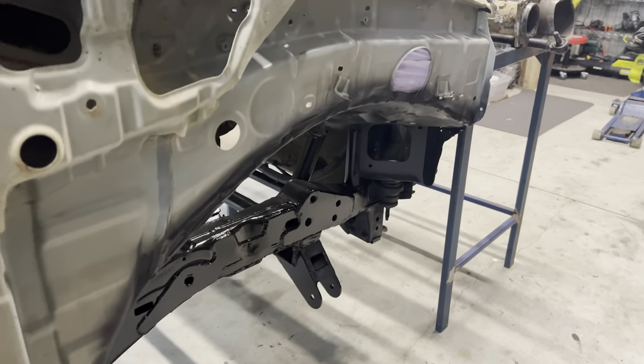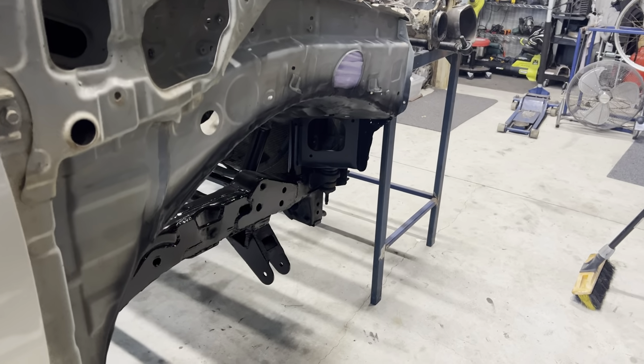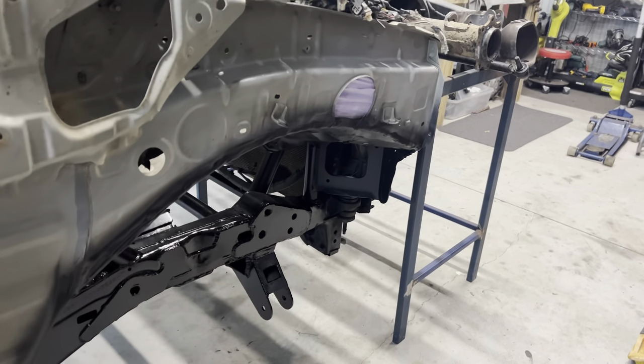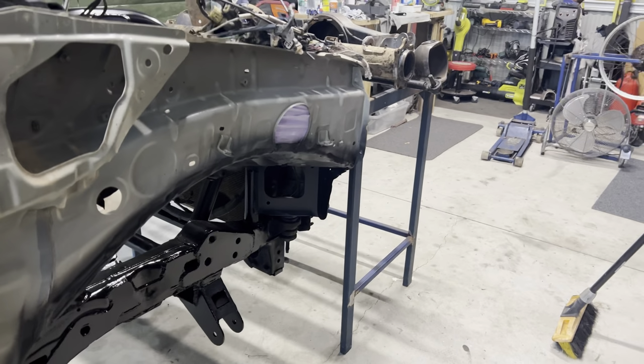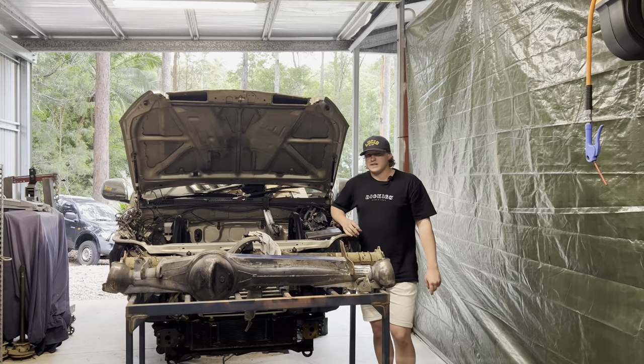So you can see down there, I have the panhard mount that comes out. Try to get it in line with the edge of the drag link. Same notch, because when it's full articulation this way, the coilover wants to hit my steering box mounts. So yeah, again, I'm really happy with how that's all coming out.